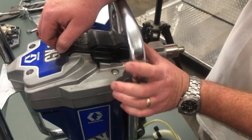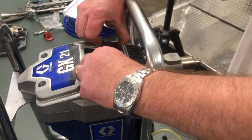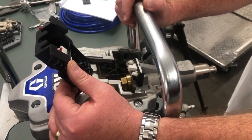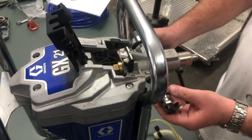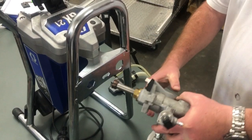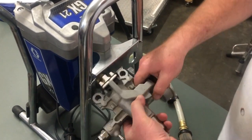Take the cover off, and once you've opened this cover, it actually disconnects the electrics to the pump so you can't get your finger stuck in a running motor accidentally. Then you take the whole pump assembly out, turn the machine over, and there are all the tools you need stored on the machine to completely remove the pump.